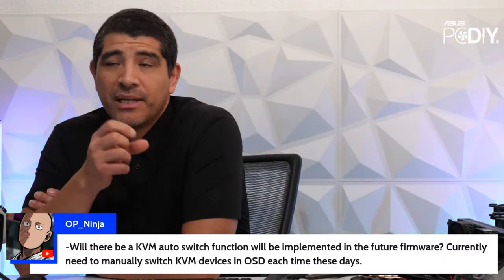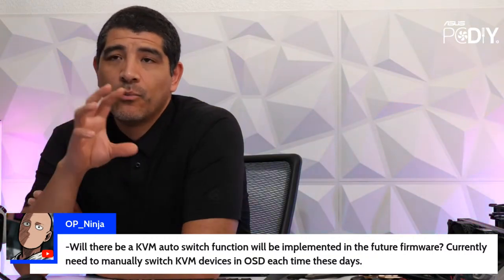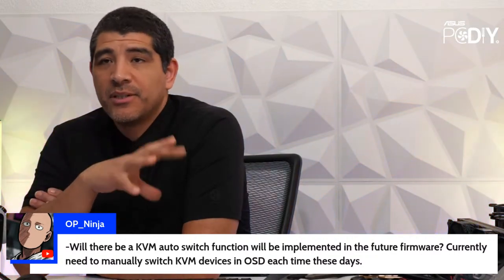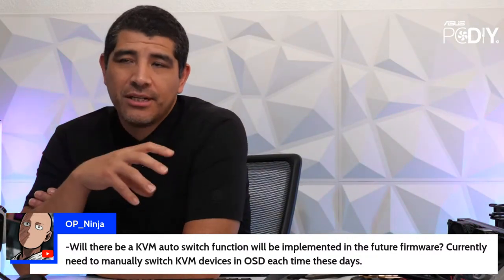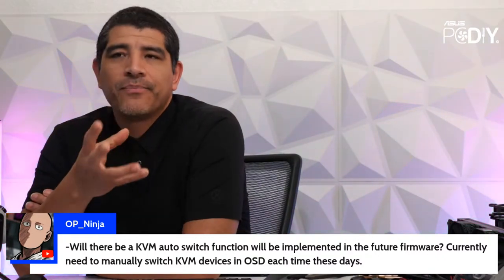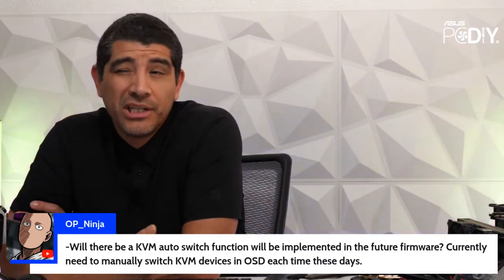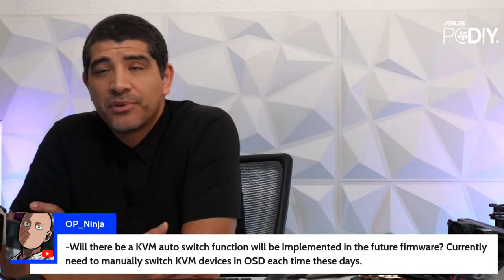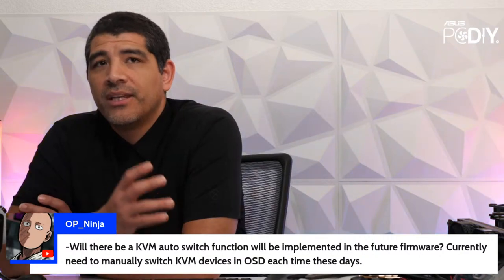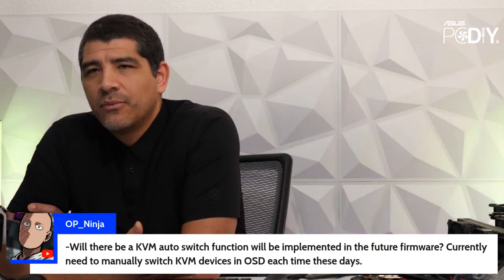Part of that is somewhat dependent on the design of the electronics package that can vary from one panel choice to another. There are things called the TCON that can vary between Samsung and LG. So there are some factors in there that can complicate having certain types of functionality and features. But right now, I don't believe so. I'll definitely feed back to our team to see what options we could introduce to do that. Since this unit does support Display Widget Center, maybe we could put in a hook to allow you to more easily toggle the KVM functionality through Display Widget Center. So you could do it through that route. That's something I think we are already looking at.